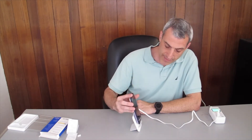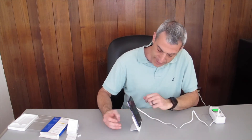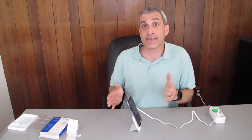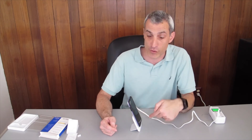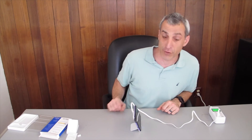If I take the phone and put it in the portrait (up and down) direction, the wireless charging does not turn on — the phone does not work in that position. The flashing light means the charger sees the phone but there's no Qi receptor in that part of the phone. However, it will work in the sideways landscape position — the light is now solid because it's charging.